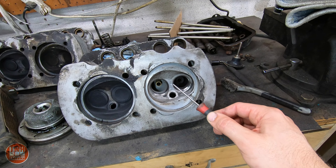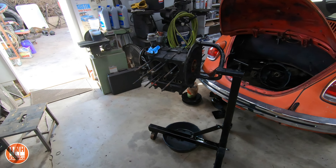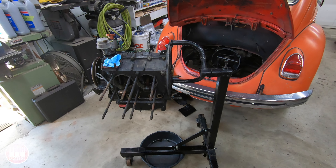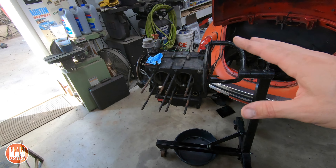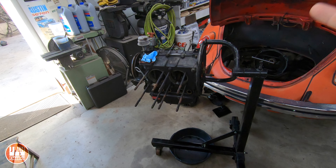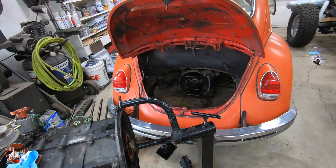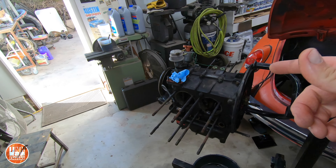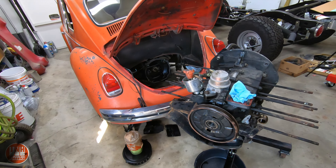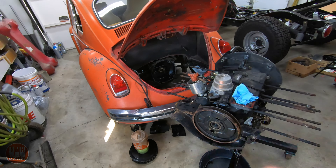I got a comment on that disassembly video — somebody said hey, was that a crack between the valves on that cylinder head? I came out here and checked and sure enough there is a crack on this head. There's a ring here for the valve seats and they're not cracked and they seem like they probably seat just fine, so this crack here is maybe fine and maybe doesn't hurt anything. But I'm concerned about it and I don't really want to have to take this all apart again because of something like this. So I'm looking into my options — maybe new heads or maybe repairing this one — I'm not really sure exactly what's going to happen there.